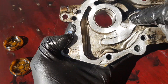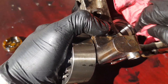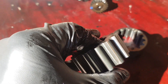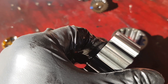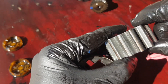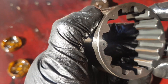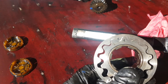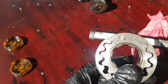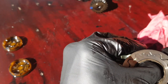This side of the oil pump housing is scored. The other side looks good, but that is not the biggest problem. Look at the oil pump rotors — those are the real issue here. The inner rotor and outer rotor are worn out. You can easily notice the discoloration on each tooth and its shape is deformed. There are many ways to check them: you could place a light under the rotors and check how they match, or even measure them. Based on visual inspection alone, the oil pump is not good, and in this case measuring would be a waste of time.